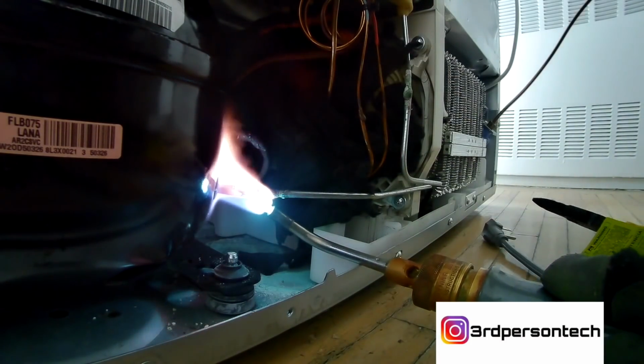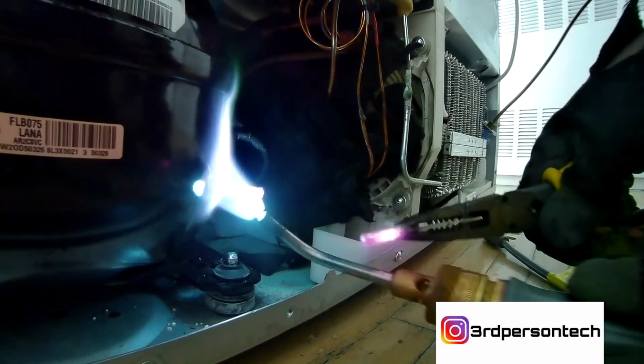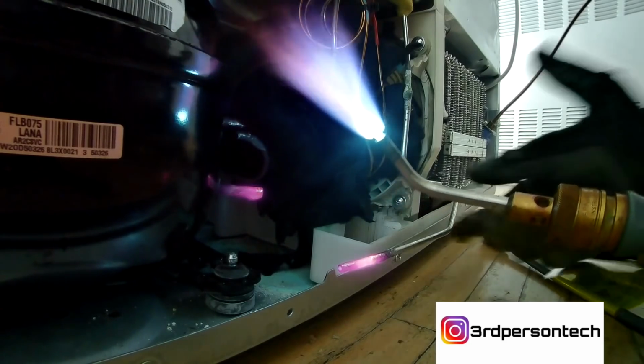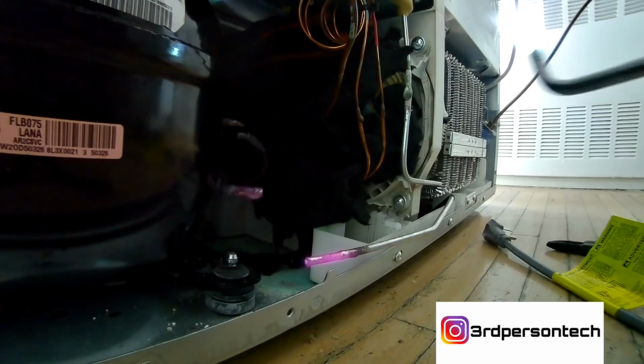Pull it out, get a pliers. I use a needle nose pliers. Some people call this pliers the bird beak. Pull out the pipes. It's easier to get the copper or silver pipes out. It's burning, so try to not make it touch the floor. Try to keep your torch away from the customer's floor. I've had a couple nightmares like that.